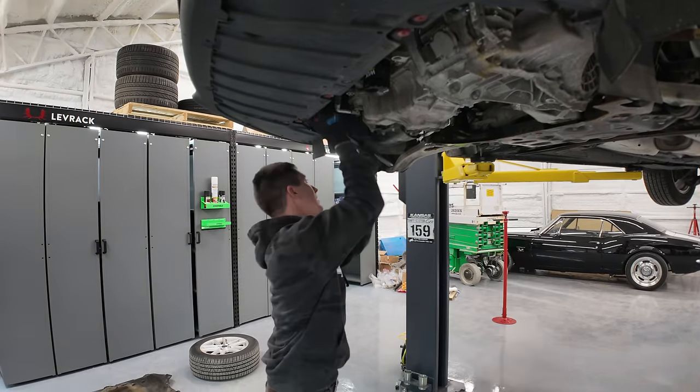Yeah. Now we got to unbolt the clutch forks there. They do have to go back in the right order, so don't mess this up. First, I'm going to spray this all out with brake clean so it's nice and pretty. And once we get it all cleaned up, we'll keep going. What is it? I think it's four bolts on each one of these. There's two Torx and two E Torx. And once you get all those out, you can start throwing in new parts. And we're also gonna replace this cover there on that main shaft. So not too much to do, honestly, once it's apart. And we'll tear the puller back apart, clean up the case, and keep rocking.